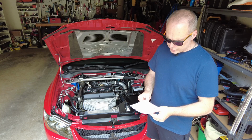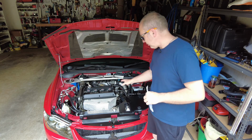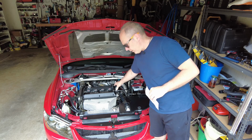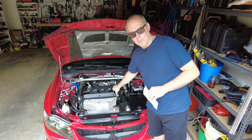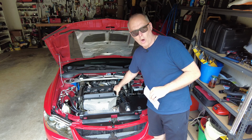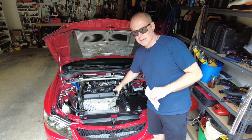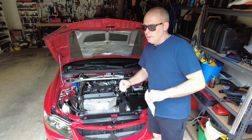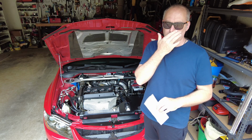Yeah, probably the biggest issue I had with the unit are the breather ports. The universal norm for all these kinds of oil fittings is ORB fittings. So they would normally use an ORB to O-ring, which is basically a straight-sided ORB with an O-ring on it. This guy decided to use M22 threaded holes. Really hard to get M22 threaded gear.